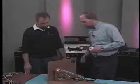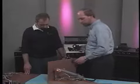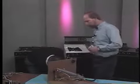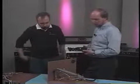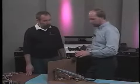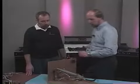We can simulate that. We can turn the burner off. And we can lower our voltage here to about 70 volts. And what you'll see, we'll let it turn off here. What you're going to see is the glow bar will glow, but the amp meter won't get up to 3.2 amps, which is what we need for this type of glow bar.